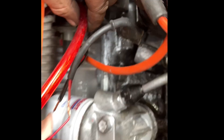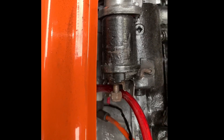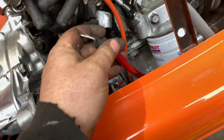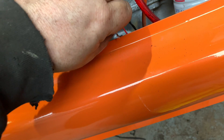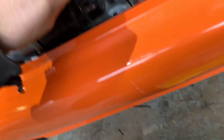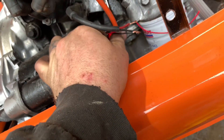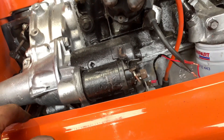At this end - so this is the main 12 volt cable which is coming from the battery bank at the back. Now I need to connect this to the main post of the starter. To do that it needs one of them - let's get that crimped on that wire. There we go, as if by magic, there's the lug on the end, all crimped on with my little hydraulic crimper. Just need to connect these wires here - they're the ones that go to the distributor and the coil that's tucked down there, just twisted them together at the moment to keep them all together. That has got to go on there, but I can't put the nut on there properly yet because I've got to take the other wires over from in the wheel arch to feed the rest of the car through there as well.